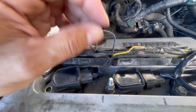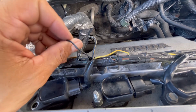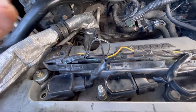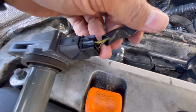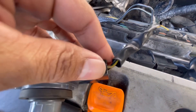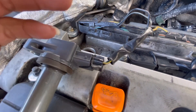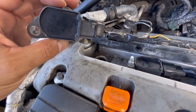I got the wires out. I didn't cut all of it because I'm probably going to splice right here. I took off all the electrical tape up to the little wire protector. Now I'm going to take out the ignition coil and disconnect it. Make sure you remember how these are oriented because you'll have to put them back the same way — the new connector doesn't have any color markings, so take a picture or write it down before you take it off.